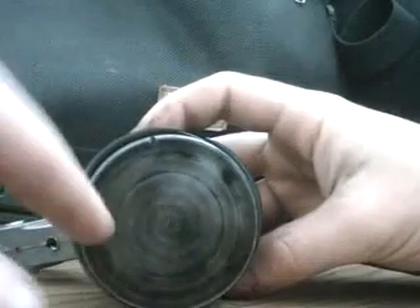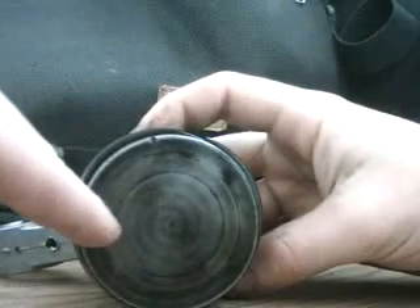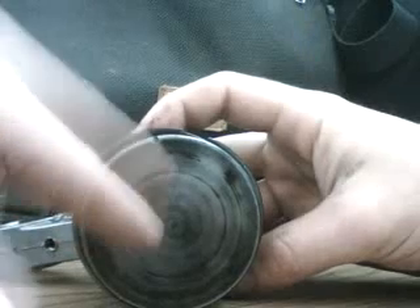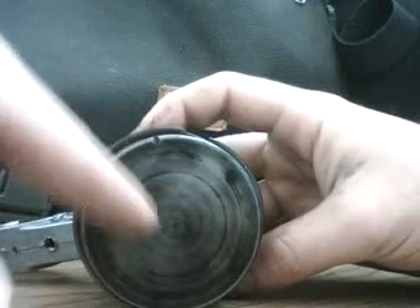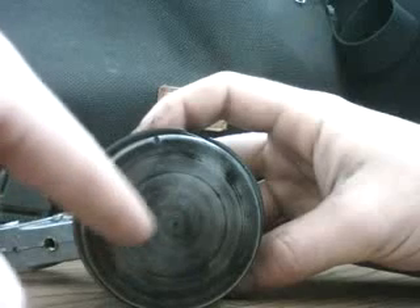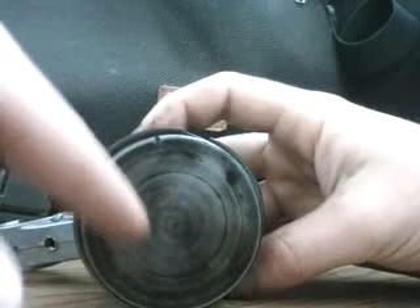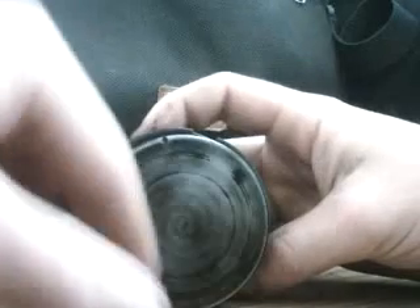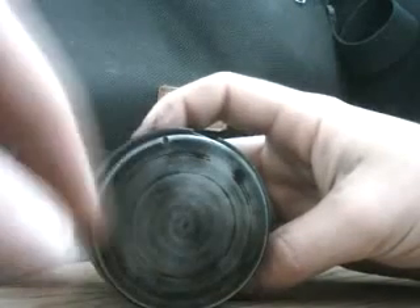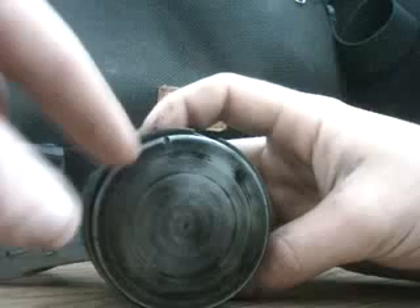On the crown there would usually be an arrow, and you want that arrow pointing to your muffler port when you install your piston. This part doesn't have the arrow on it — as I said, this is a throw-out.